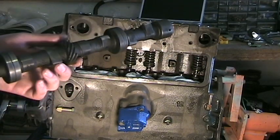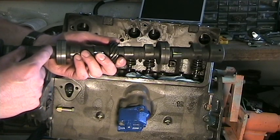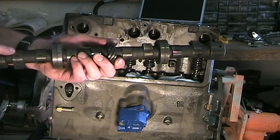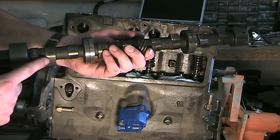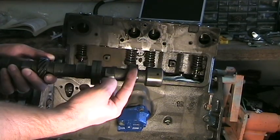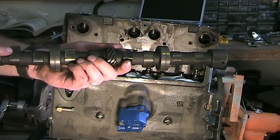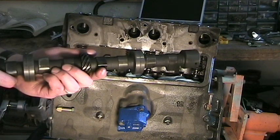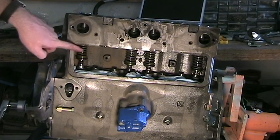The way I was taught was to look at this as one cylinder — this is number one — which has an opposing cylinder, number four. By opposing, what we can see is when this cam lobe, for the exhaust valve, is pointing straight down, number four is 180 degrees out, pointing straight up. So what we want to do is turn this so that the opposing valve to the one we're going to adjust is in its full up position.